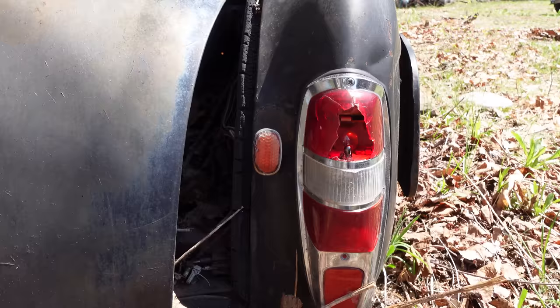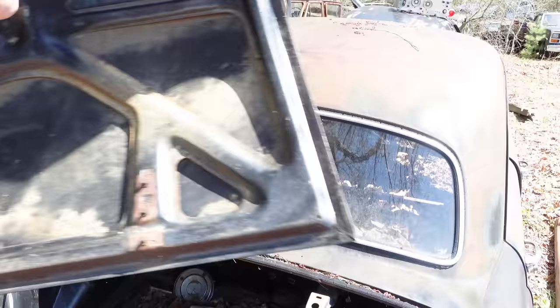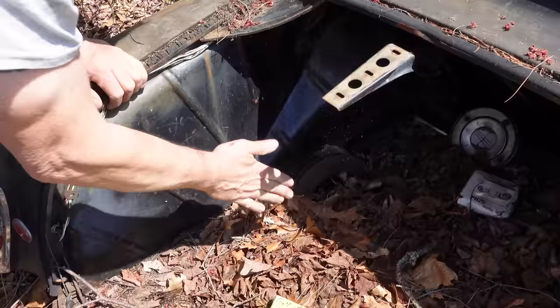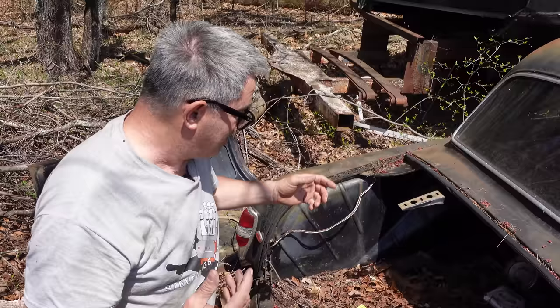And in the trunk, what do we have? Okay, yeah, signs of the original shiny black right here. In effect, and again, the underside of the trunk is always the most protected area on any car. We can see right here, once again, unitized construction. The trunk walls are part of the inner structure, the floor, to make the tub very stiff, the inside of the car. And again, this is a crumple zone back here, and Mercedes-Benz, I think in 1952, patented crash and crumple zones on passenger cars, and here they are in effect here.